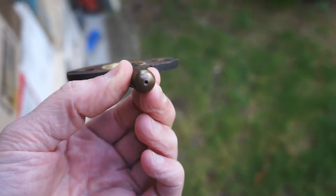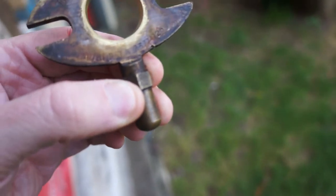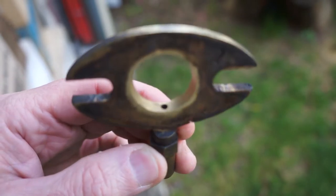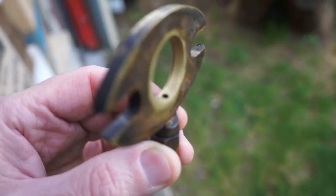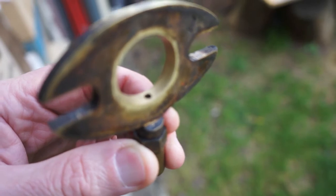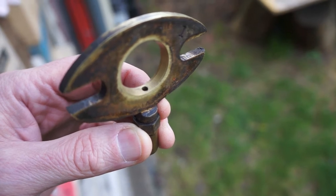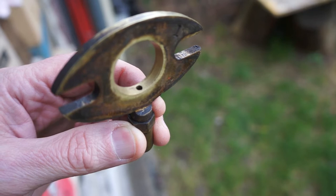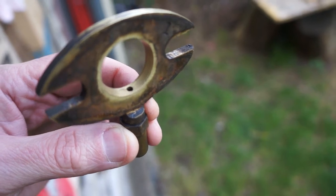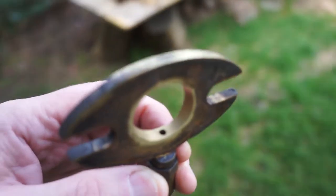The way it works: you can see there's a little hole there, and underneath in this little chamber at the bottom there's another hole, and inside there's a steel ball — you can hear it rattling. Looking at the opening in this piece of brass, it's actually cone-shaped, so that creates the venturi effect. The fuel-air mixture rushing through into the inlet manifold creates a vacuum, and the degree of vacuum will raise or lower the steel ball, admitting more air.